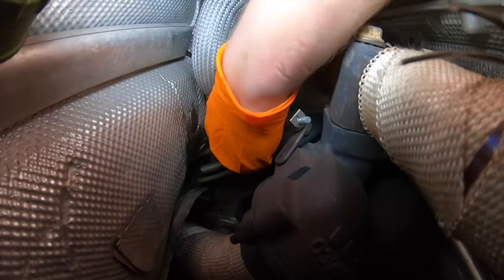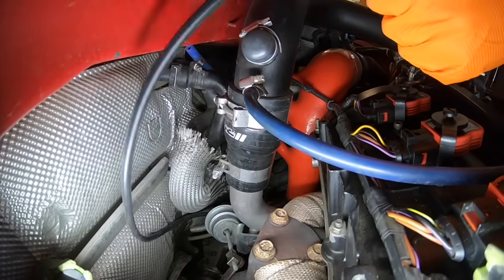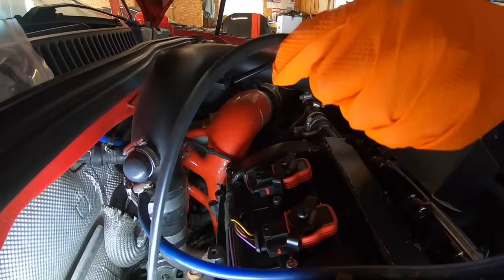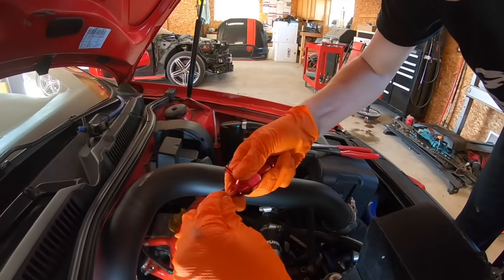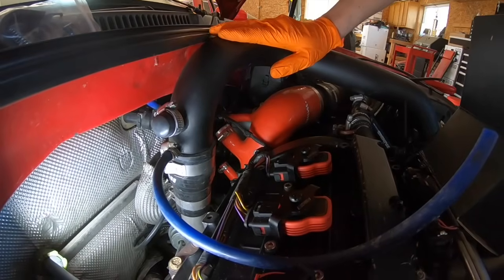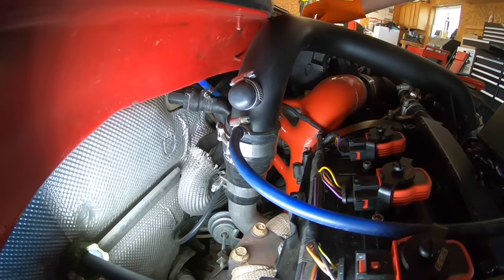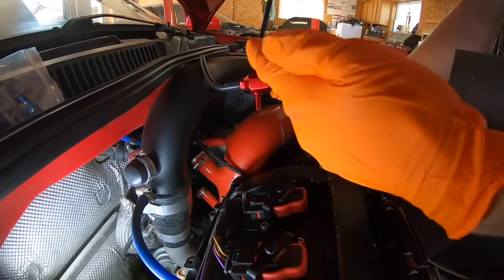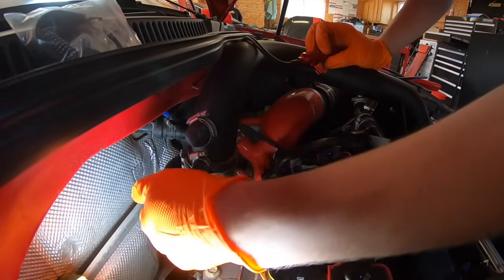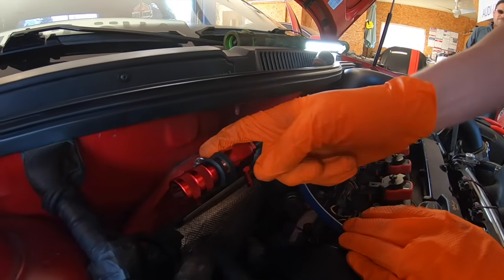It's very important to make sure these hoses do not blow off, especially to the wastegate. This wastegate has a crackout pressure of like stock three to six PSI. See how nice — that's a tight fit, that's what you want. The other one's a little loose — that can cause boost issues. This is the pressure side. On normal typical setups the turbo has a nipple on it for the pressure side because you need to see pressure. The pressure builds up and there's a ball and spring in here, so when it hits a certain pressure it's going to pop and bleed the boost off. That's how you control boost — you need pressure and you need the wastegate side, because it gives it the pressure to either bleed it off or hold the wastegate totally shut.